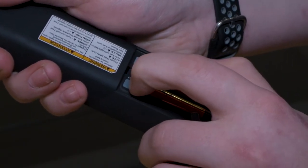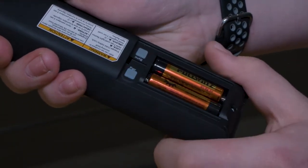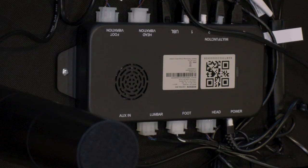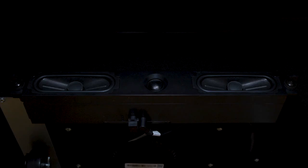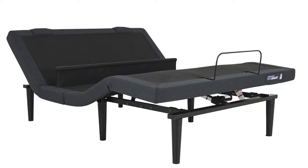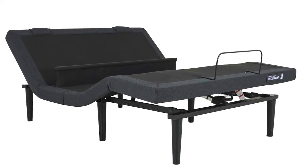Press and hold the pair button on the back of the remote. The pair button will illuminate and start to flash. When the pair button stops flashing, the LED light on the control box will stop flashing. The sound bar will provide the verbal cue to indicate the remote has been paired successfully to the control box. Release the pair button. Setup is now complete. Test all functions on the remote.